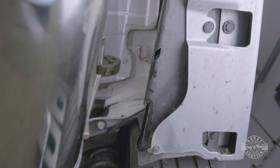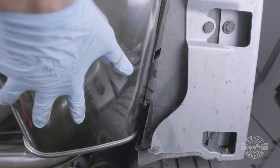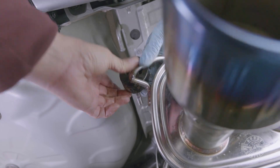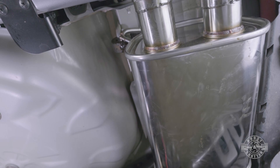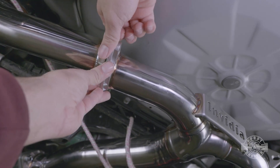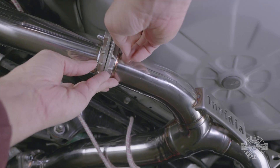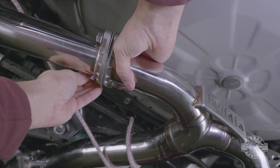Okay so now grab one of the mufflers and first hang it on the outer hook. WD-40 will make this very easy. When done put the hanger on the inside hook and just slide it in place. This should be very easy and the muffler is just gonna dangle there again. The other side is exactly the same, and just like we did the rear pipe we're gonna grab a metal gasket from the kit and two bolts and nuts and we're gonna loosely install it by hand. The reason we're not torquing anything down yet is because we want to make sure that the mufflers are lined up right and that the tips look good on the back of the car.